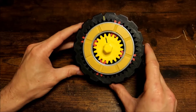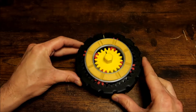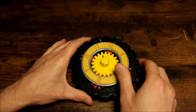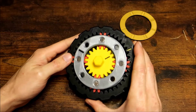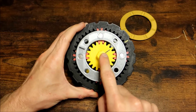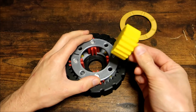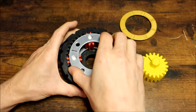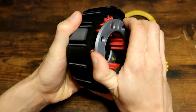So ultimately, your planetary gear set is going to consist of several different pieces. The first thing I'm going to do is remove this little thrust washer so we can get a better idea of what's going on in there. We have a centralized piece right here, which is known as the sun gear. So I'm going to go ahead and pop this out of here.